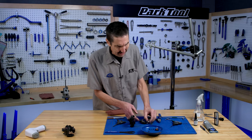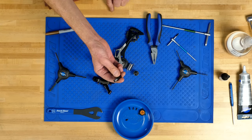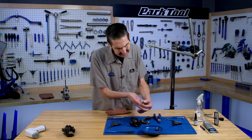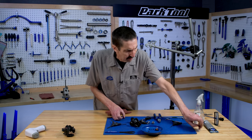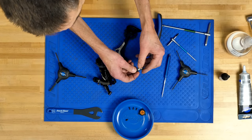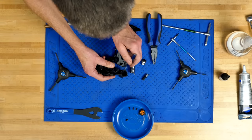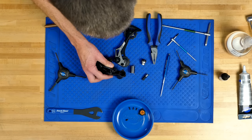So that spring is out. And in here is the stud with a nice machined surface — that's for our clutch pack. I can spin this easily in one direction, but it doesn't want to turn the other way due to the roller bearings inside. The little roller bearings are designed to jam against the steel stud here, and that gives us our resistance. That's how it goes one way and not the other. Inside the body, there is nothing — this is where we would be cleaning, degreasing, that sort of thing.